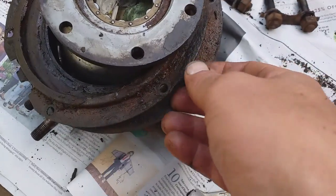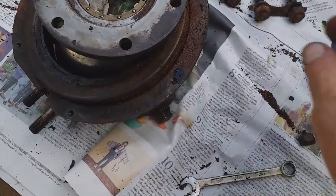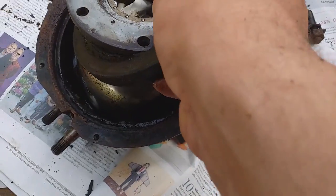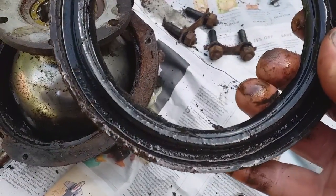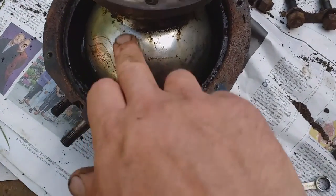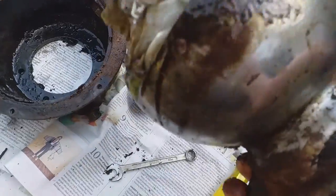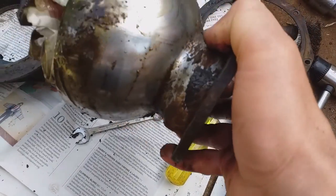Including the oil drain plug there were seven bolts, but really just six holes for the retaining plate of the seal. Here is the seal - I've knocked this out with a cold chisel. That's the old seal which was leaking, but not as badly as the other one. Now provided the bearings aren't sticking out from the edge of the swivel, the swivel should just lift out. I stuffed this one full of newspaper because there was some residual oil in there. It's got minimal pitting - a little bit around the union joint area but that's not important.